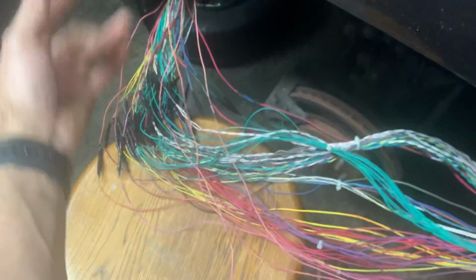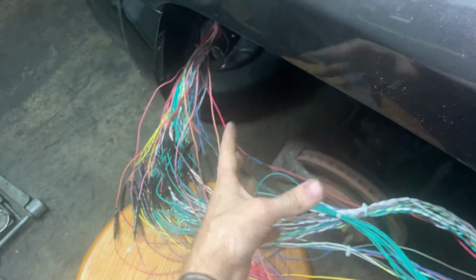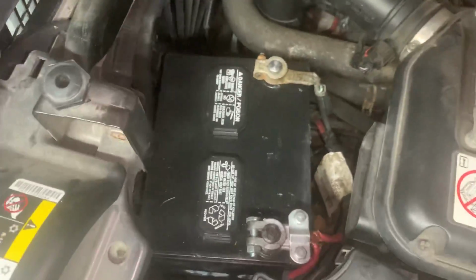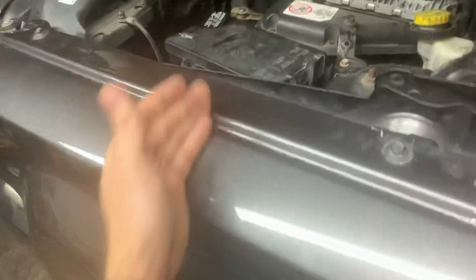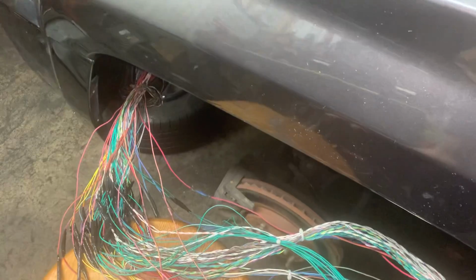when those got ripped up with the tire blowing up in here, all those wires were live. They had live electric current running through them, slapping everywhere. And until that battery got disconnected, all those wires were arcing against each other as the tire was ripping it up, shorting all kinds of stuff out. And it blew out fuses, it blew out relays. But after it blows the relay and there's still electrical current, what's it going to blow out next? The component that it was attached to.